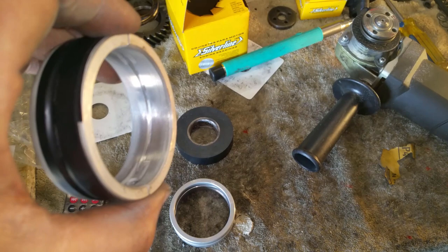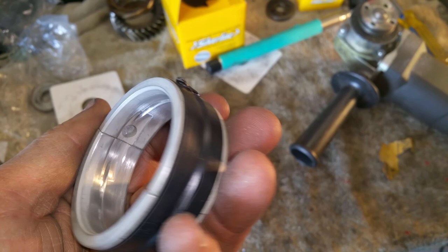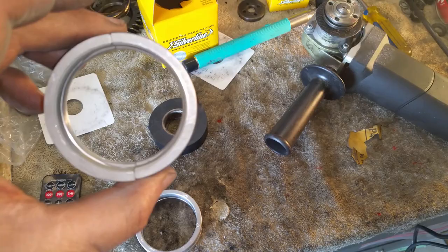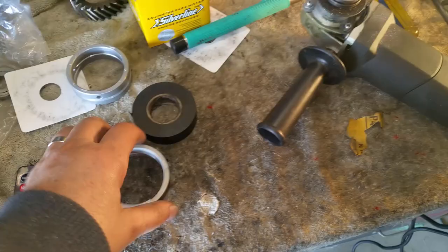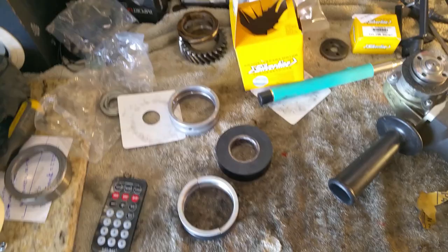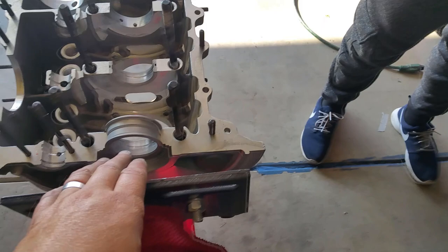That's two done — I already sanded it with 400 grit. This is the two-piece, I use electrical tape to keep it together. This one is steel-backed, very heavy. The trick is buying two Clevite bearings and using the steel-backed dual-split ones. For the main big bearing I'm going to have to completely change the orientation so that it grinds right in the center.